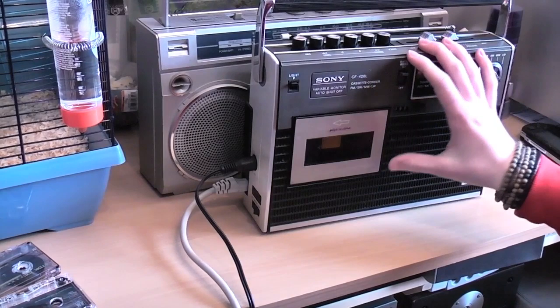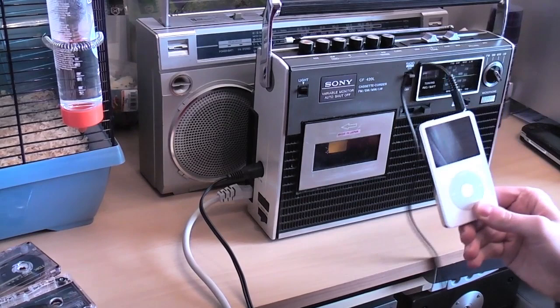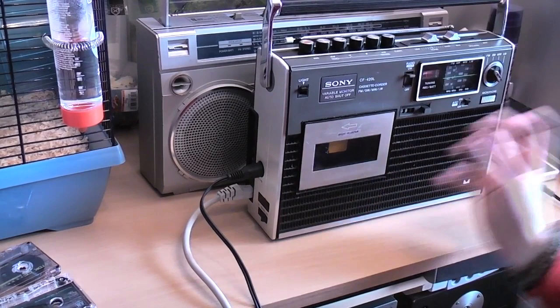Now through this particular radio it's not the loudest, but the cassette does go louder. I think a lot of these DIN connectors work in various different ways. Now the signal coming from an iPod is not that big because it's designed for headphones, so it does need to be pre-amped in such a way. If it's not pre-amped you need a pretty powerful amplifier to hear the signal. But it goes pretty loud — what you've got to remember is my camera bumps down the gain when it hears audio, so you can't get an idea of how loud it is.